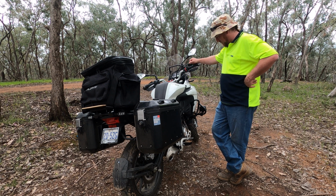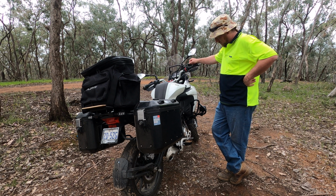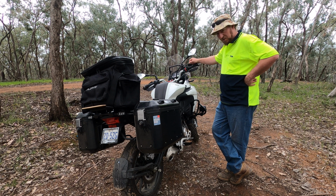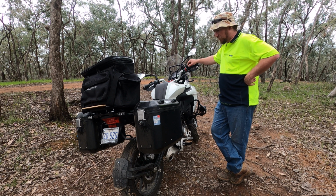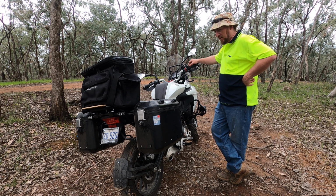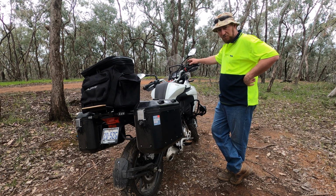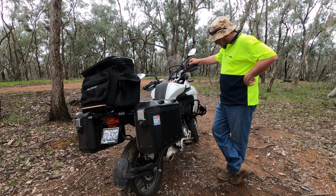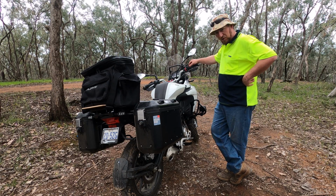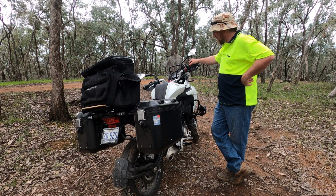Of course, 650 over 500, being a side-by-side twin, not a V-twin, whatever you call it, 2-cylinder motor as well, which they reckon are pretty bulletproof. So it's due in for its first service, which will be at about 1700 k's. Until then, a little bit restricted. I can't really go over 5.5 grand on the speedo, just letting the motor settle itself. So once that's done and I can achieve highway speed, I'll be getting away and doing some more.